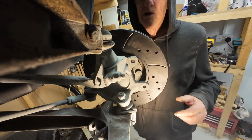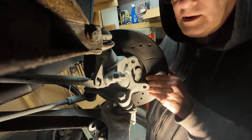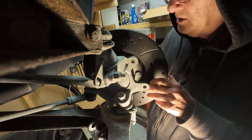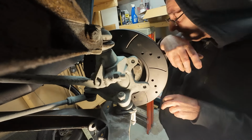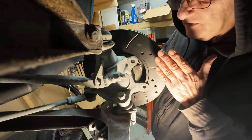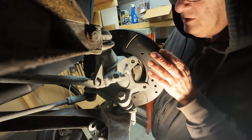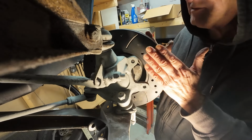So that's a BMW E38 7 Series Brembo 4-pot caliper, aluminium. As I've already said, it's lighter than the standard one, because that's iron. If I fit it, like I've just shown you on here, the caliper fits perfectly onto that disc, central.